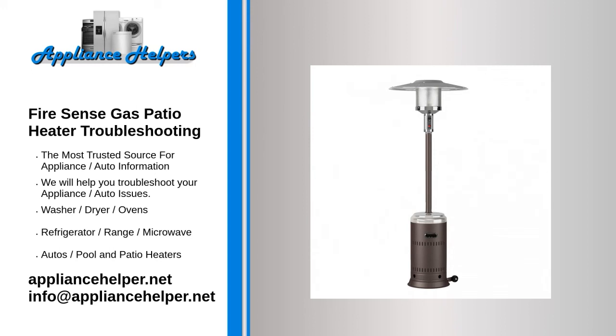Remove the emitter screen to expose the burner or element. Because these should be kept dry, use compressed air to blow off dust and dirt instead of a damp cloth. Reattach the screen. To clean a gas burner's individual ports, remove the emitter screen and take a pipe cleaner or straw brush to remove dirt and debris. Once clean, reattach the screen.